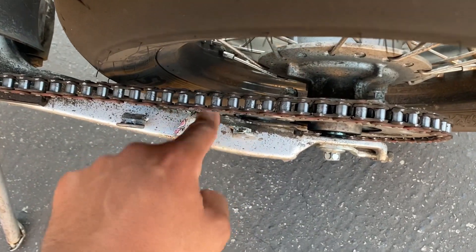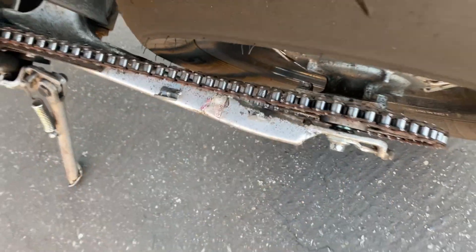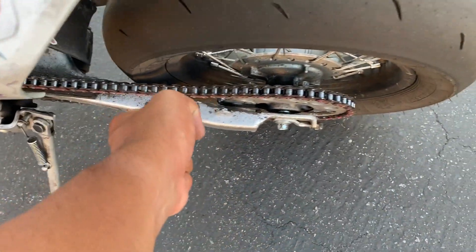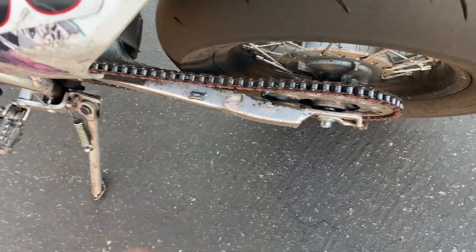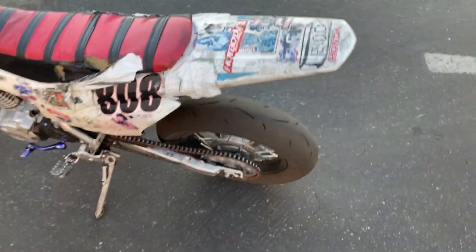On the rear, the swing arm had a little piece of metal sticking out from the inside right here that stuck out a little bit and prevented the wider 12-inch wheel from fitting in there. What I did was get a Dremel and grind it all the way down, took that little metal piece out, and then the wheel went back and forth in there easy.